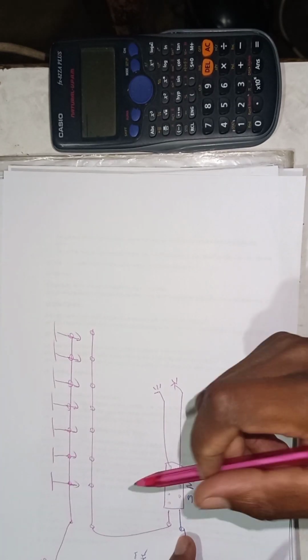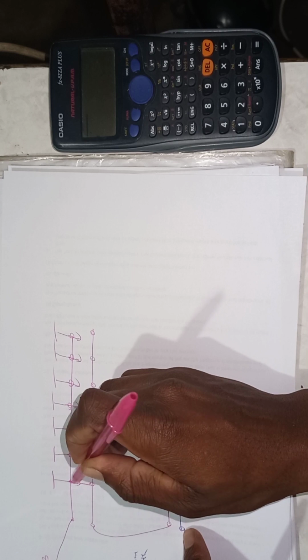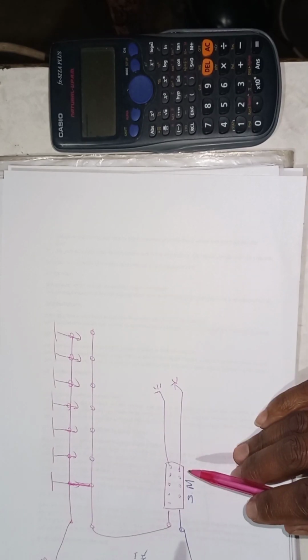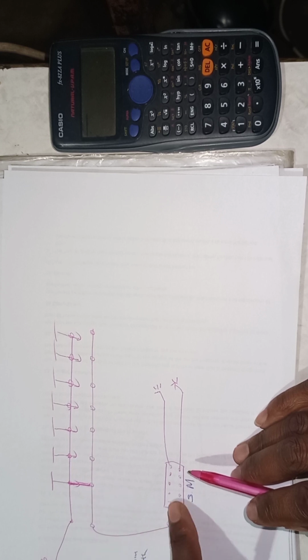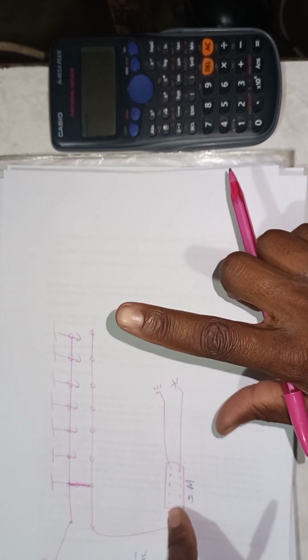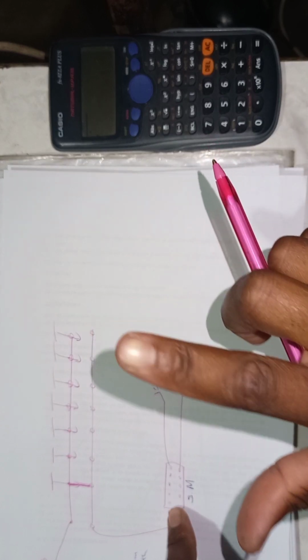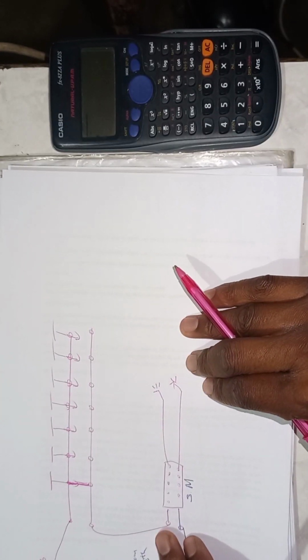You only get a short circuit when you push the button. What happens when you push the button? You are shorting here. So electricity now finds a way to go through and comes to our spark module and powers the spark module. Then every igniter, 7 of those igniters, every electrode, 7 of our electrodes will create a spark.